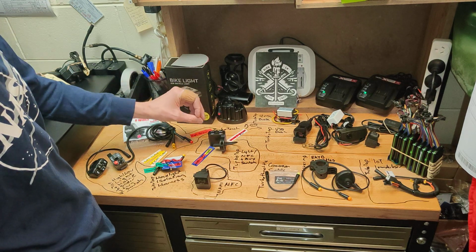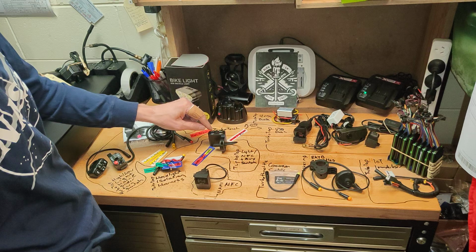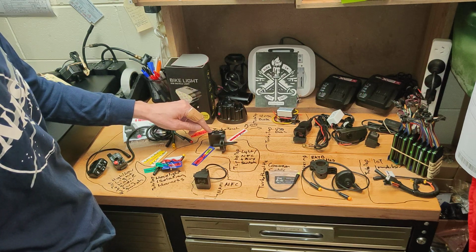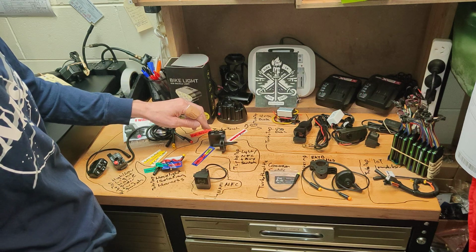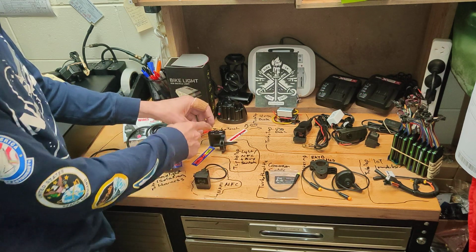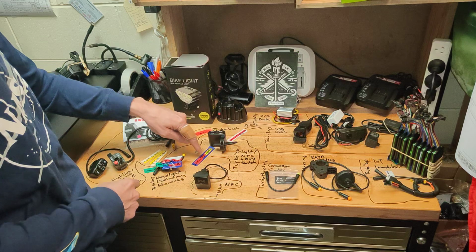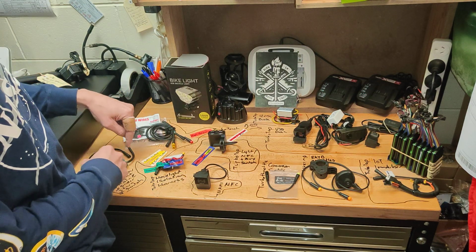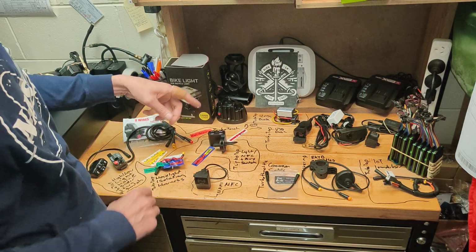And I think if you didn't want to use the NFC functionality of this, but you wanted to use the light functionality, then it would just be a simple matter of unplugging this switch's wire from the NFC to this isolation harness for the headlight. And so you can basically dual purpose it, one or the other.